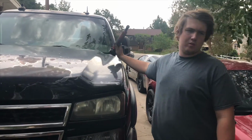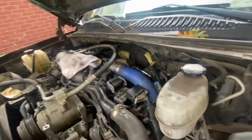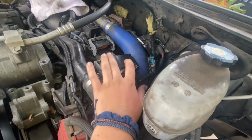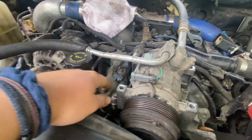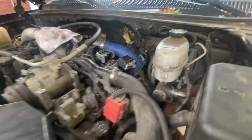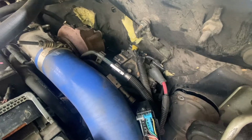Sweet. So the rain and wind have stopped. So we're doing the driver's side today. We're gonna start by pulling off the connectors out of the way. They have bolts under them, and that whole bracket comes off. Then we got to get this top coolant pipe off. This is where the thermostat sits, so we'll unbolt that, and that'll come off. And then we'll get the boost pipe out of the way, and the glow plug box, and then we're gonna get some fuel line remover tools and get those fuel lines out of the way also.